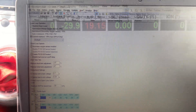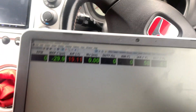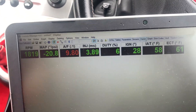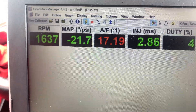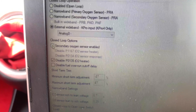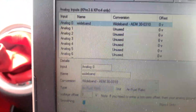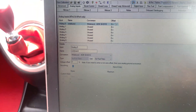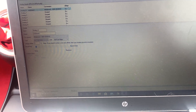So that should now be switched on and working. The wideband is actually reading now and I haven't even started the car yet. This is a dodgy map I got from the vault — obviously my car needs properly tuned. That there is still reading its heat-up. Once it comes up it should start working. I've also disabled the secondary oxygen sensor, so we're running primary off just the external wideband now — that's under closed loop, external wideband, analog input. And that's fitting an AEM wideband gauge into an EP3 and to the K-Pro V4. This car is now ready to be mapped. Awesome, thanks for watching.